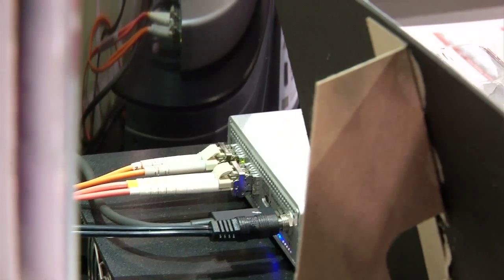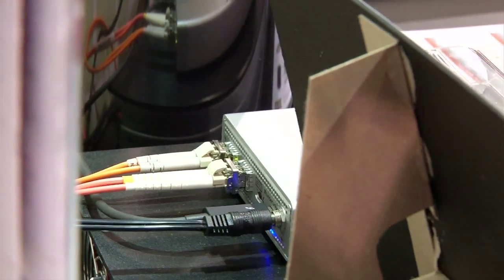There are a lot of people who may be puzzled as to why they would want to do this, but I think the simplest way to say it is it's Thunderbolt to anything. I can take a Thunderbolt camera, I can take a Thunderbolt hard drive, and as I'm running it, I can then share it out through the four different connectivity methods: 10 gigabit ethernet, SAS, fiber channel, and SAS RAID. So you really increase the options of what you can actually do with any given device.